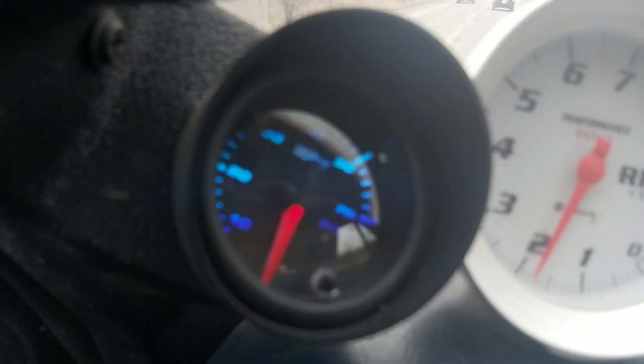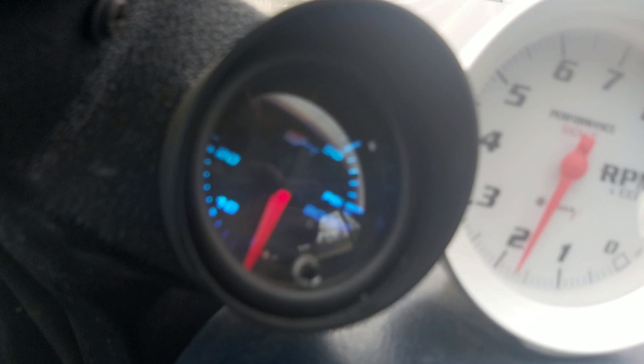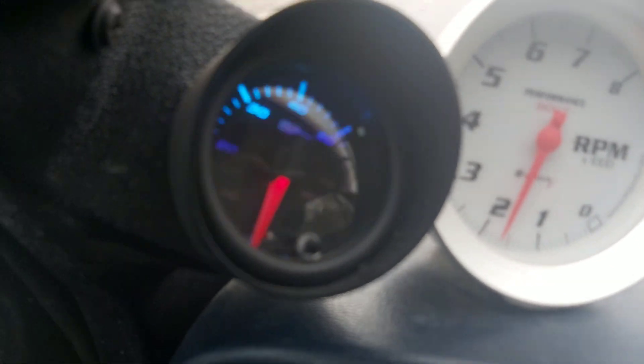I don't know how much faster it is just from a dead stop, because it still seems to take a bit to get the turbo started since the turbine wheel and compressor wheel are so heavy. But once you've got some boost, it builds boost sooner now at less throttle input. And once you have that started, it's pretty fast to spool from there — from over 4 pounds.